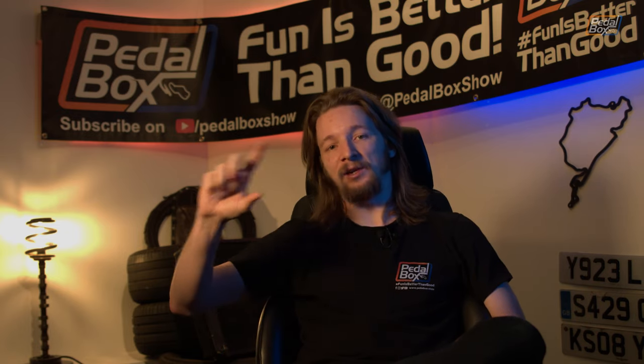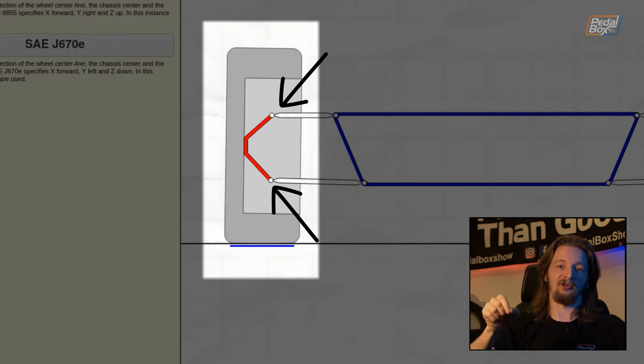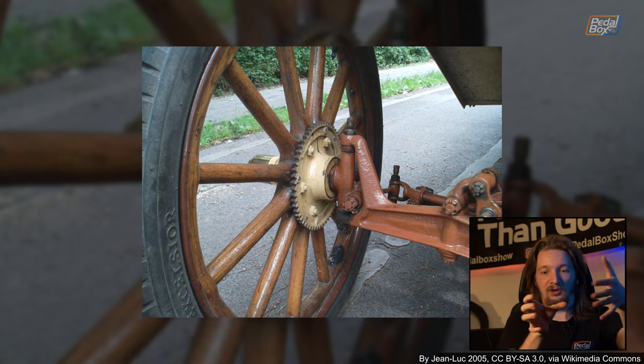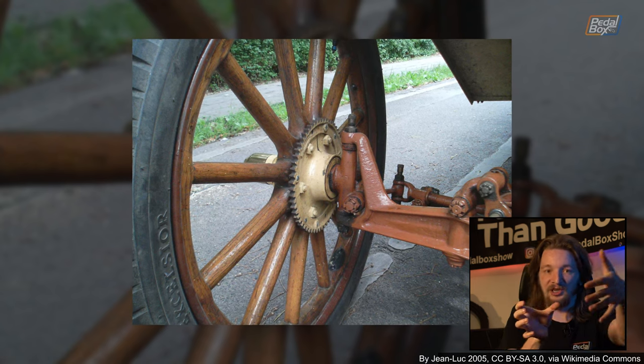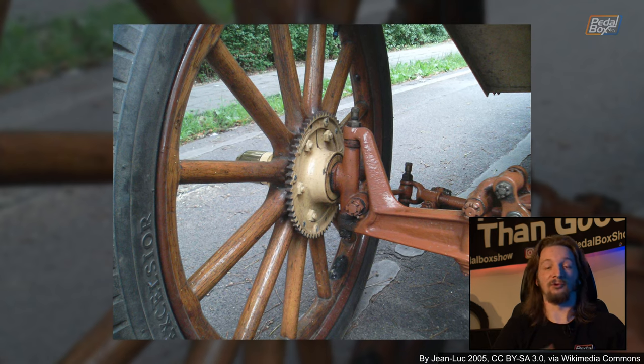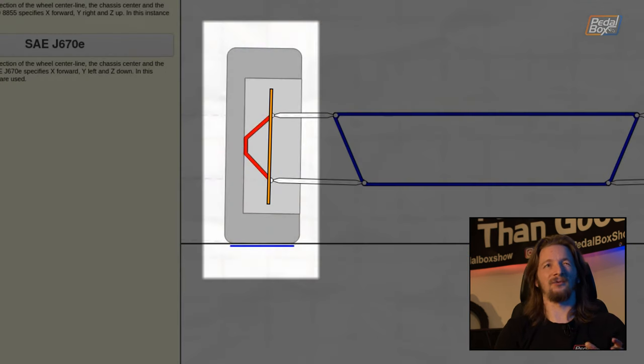Once you've punched in the lengths and angles of your control arms you can look at the wheel end of both arms and look at the two pivot points. If you draw a line from one pivot point to the other, we can call that your virtual kingpin. Once upon a time cars had an actual kingpin that the steering assembly would fit onto and the wheel would steer around this pin. We don't have those anymore, but from a mechanics point of view we have a virtual one, and this describes how a lot of your steering geometry behaves.